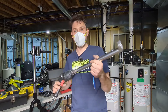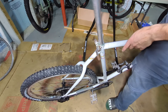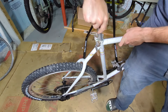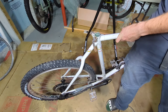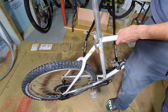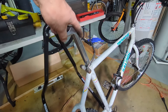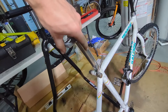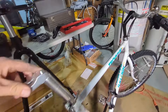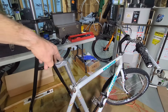Let's get a little grease in that seat tube and insert it. It's pretty good — maybe still a little tight, and it binds up a little further down in the seat tube. There's definitely something in there that's scratching it but I looked and looked and was not able to figure it out. As far as the finish goes, that is pretty nice overall. Compared to the handlebars which are just polished from the factory, I'd say that looks really good — and now I've got a seat post I can actually get into the frame that's going to look very good on the bike.